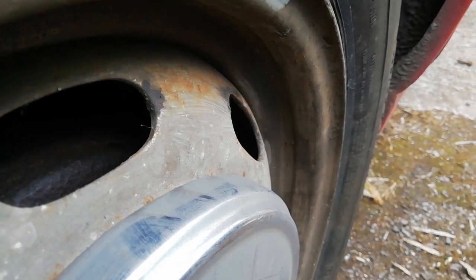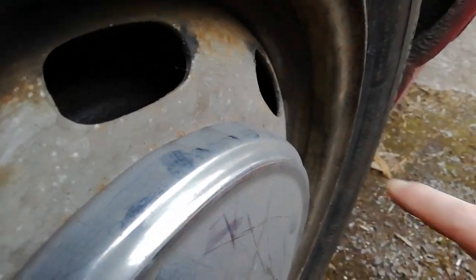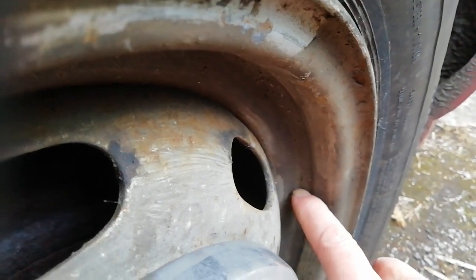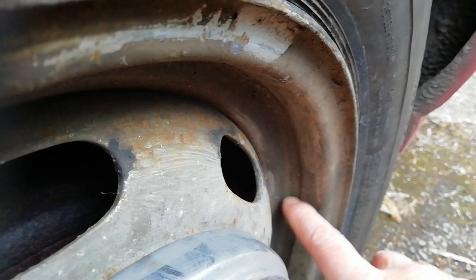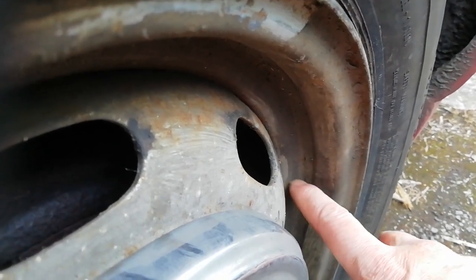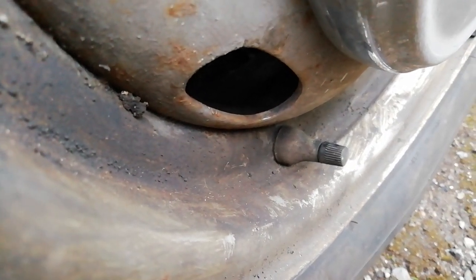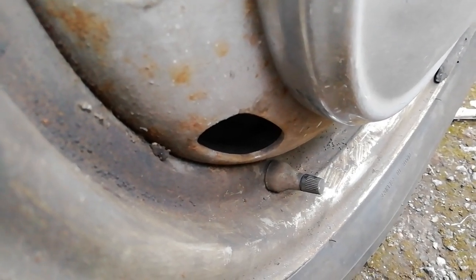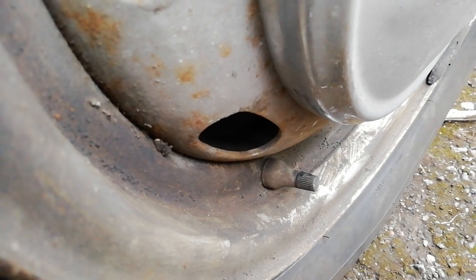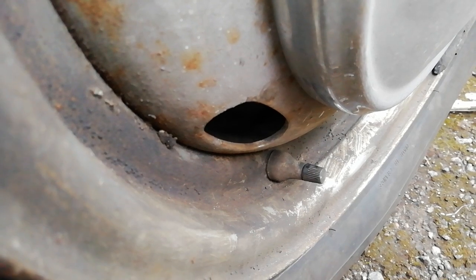Now, later on, I think late '67, you will start to get wheels that have this contour on the inside of the rim. That's to stop the tyre coming off the rim if there's a puncture, and that is desirable and nice to have. You'll notice this wheel still has the big valve. These are on an estate, they're 4.5J. Again, estates and 1800Ss have the 4.5 wheels. Contrary to what I expected, I gathered 123 GTs didn't have the wider wheel. So there.